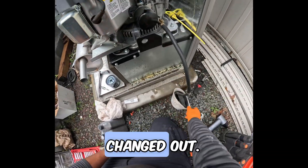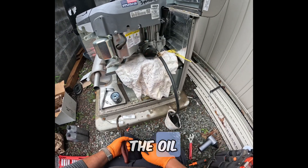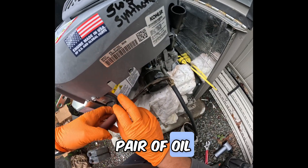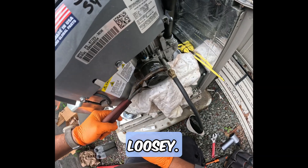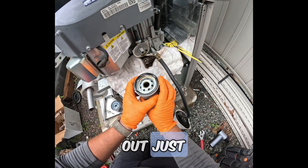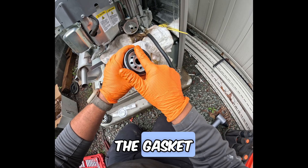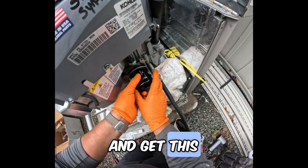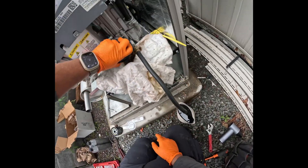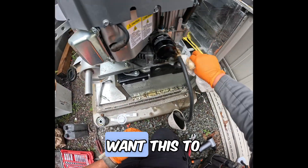Get the oil filter changed out. It looks like we've got a lot of oil out currently. So it's good practice to put an oil pad underneath the oil filter so that it doesn't make a mess of everything. Then you'll use a pair of oil filter grips like this — lefty-loosey. Once this is out, you can clean up this spot, lubricate the gasket like this, and get this new gasket on. You only want this to be hand tight. After we clean up all the oil residue that's left over — you don't want this to smoke up later.